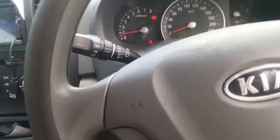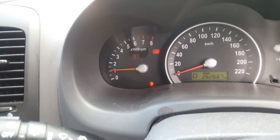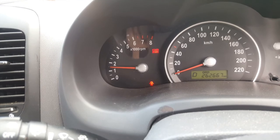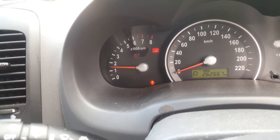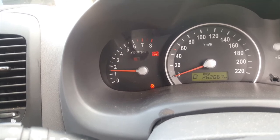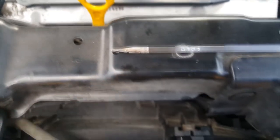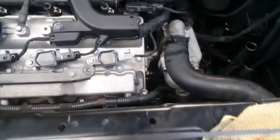I'm just going through a process right now — putting it through drive, and while my foot's on the brake, accelerating at the same time to bring up about 1500 RPM. I'm doing this a few times in reverse and in drive, just to make sure that the fluid is through the system, and so I can check if I need to add any more right now without needing to go for that drive. I'll do this another three or four times, then put it back in neutral and check that dipstick again. After doing that, she's reading spot on now — it's reading spot on when you first take it out, so that's good.